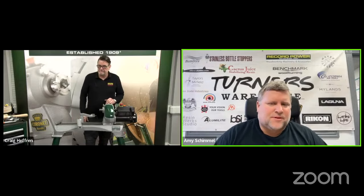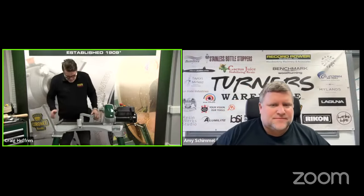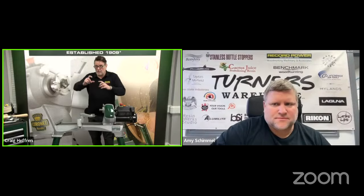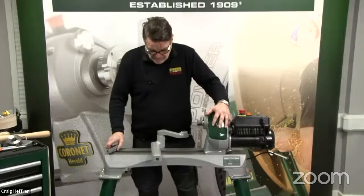Yeah, and I think some people tend to get their lube down in there or grease that, thinking it'll help, but it actually makes it worse and makes it move. Yeah, just check the pad underneath. Make sure the faces are nice and clean. You've got no resin build up. Clean them off, and I'm sure you'll get more joy with that.